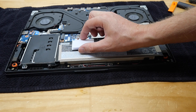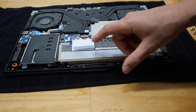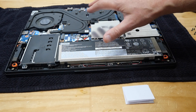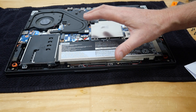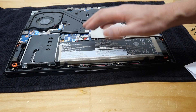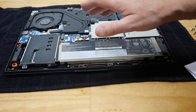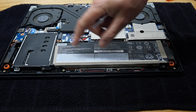What I have here is some good old-fashioned 80 GSM paper — simple as that. Four pieces, no bigger than two inches square, about 50 millimeters square. You're going to put it right by this little pin here — this pin should be holding everything apart nicely so you don't have the issue, but it doesn't. So put that just there, slightly over that pin and over your battery. It took me a few attempts — I tried card which was too thick, and sponge which pushed things too far the other way so I couldn't turn the lights on at all. Four pieces of paper was the right thickness. Your laptop may need three or five pieces, so you may need to experiment.